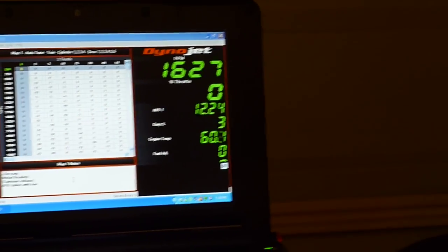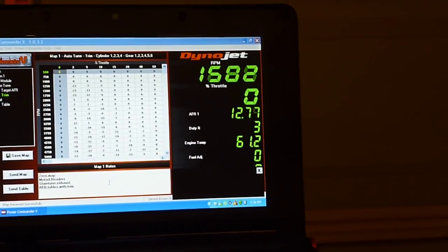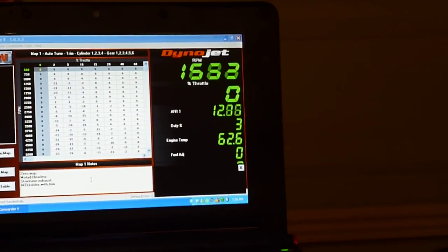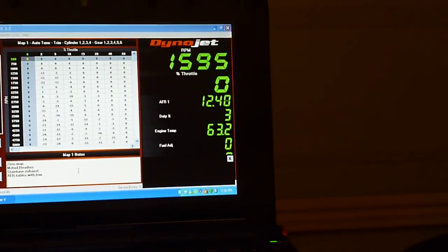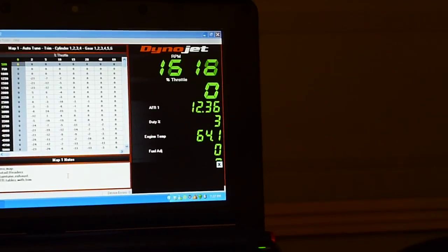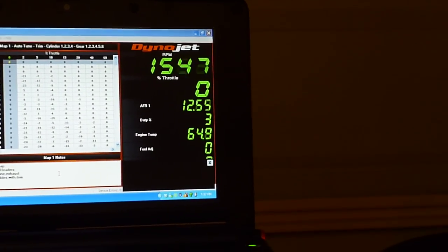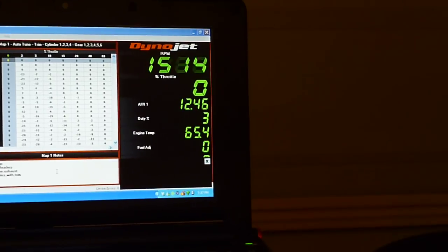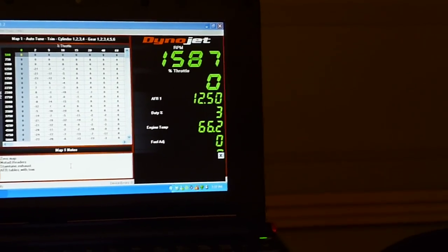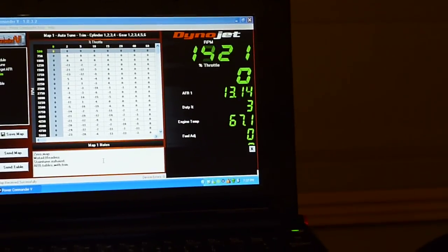Okay, I'm going to put it back on. Back on. You may even hear a slight change in the engine note. Now reading 12.8, 12.9, 13. Take it off. Dropping — 12.2. As the engine heats up and the revs drop, it'll drop down below 12. I'm going to put it back on now. Let it spike for a second. You see it goes up.